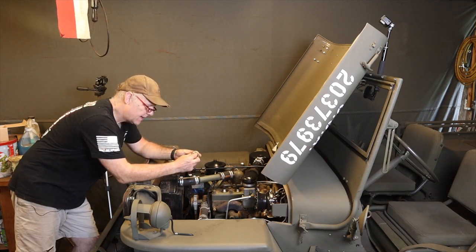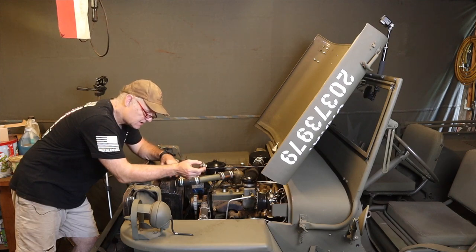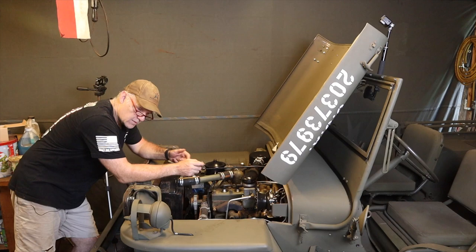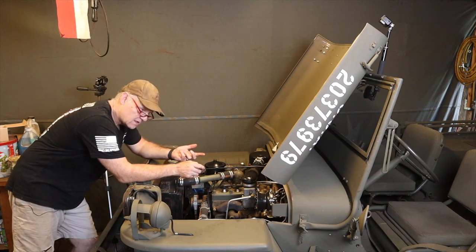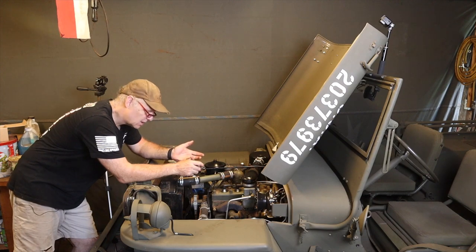So I thought about it when I got home. I actually got home, I had to stop a couple of times, and I sprayed water on the radiator. And the reason I sprayed water on the radiator was thinking that, okay, if the radiator's a little warm and the water's warm and maybe something's not working correctly in the radiator side of things, when I spray the radiator and cool it down, I don't want to spray the block because I might crack something, but if I spray the radiator down, I ought to immediately see a big decrease in the temperature. And I didn't, so that was a little bit of a clue.